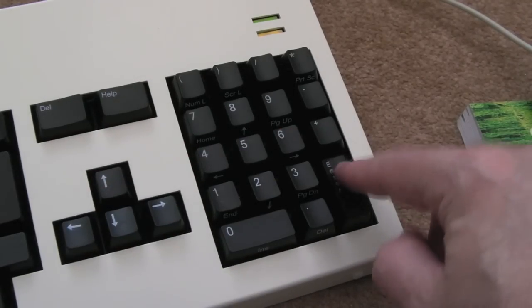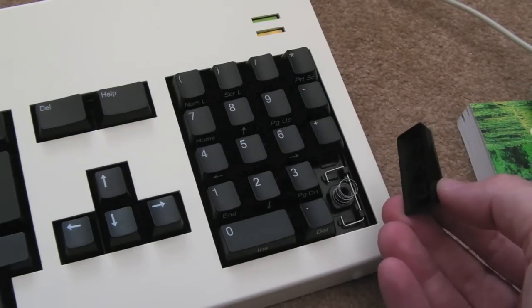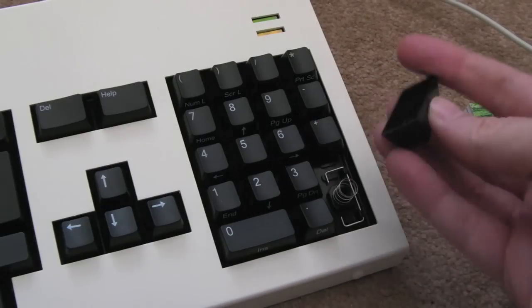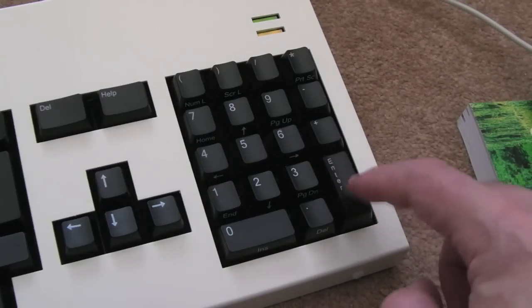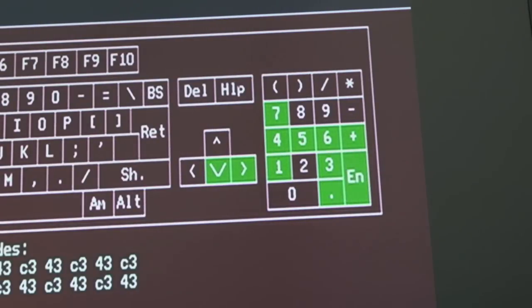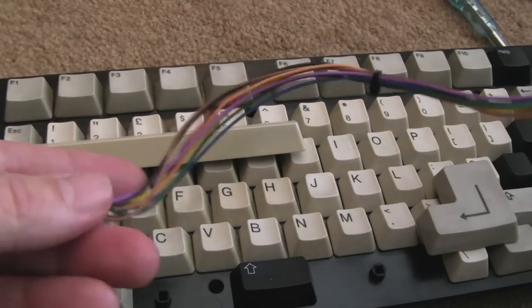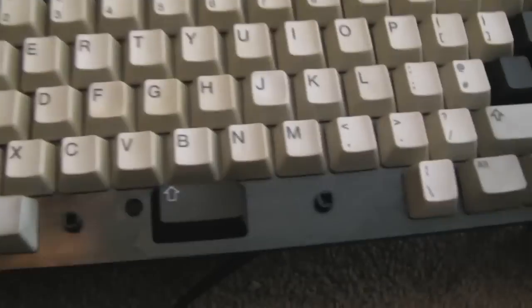We don't have that one key because that's the 500 Plus difference, but it's looking okay. Sweet — got shift there — so that's all keys, fantastic. Similar to the problem I had with the return key, I did find this enter key was a little bit unresponsive — you needed to press it the right way. If I pull the cap off, you can see it will come off just with my fingers. I've removed the white clips, so it's not using the bar — again the same problem the return key had, the alignment is subtly different by about half a millimetre.